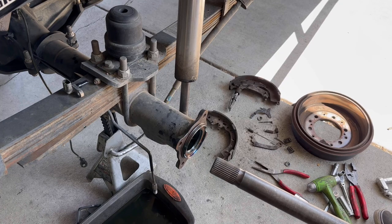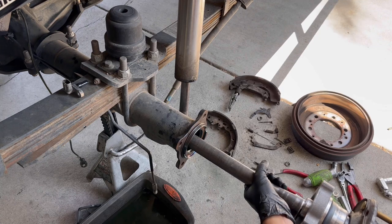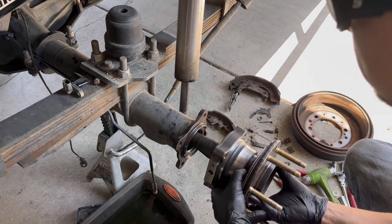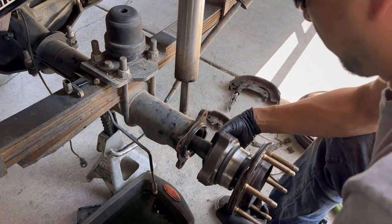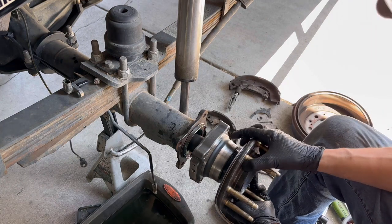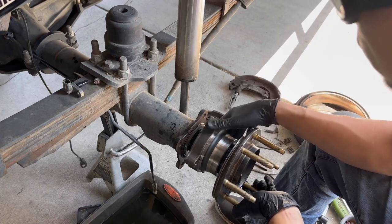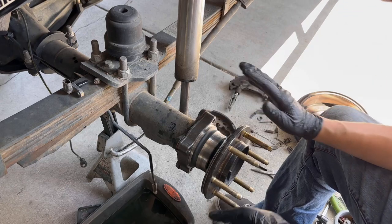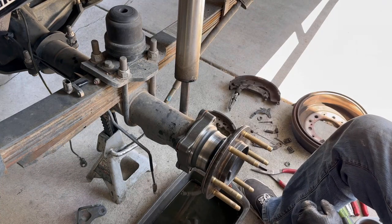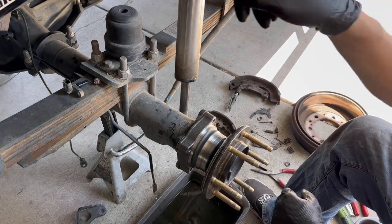When you put this back in, you do not want to let it touch the seal. And then all the way at the end, almost at the diff, there is a little hole that it needs to go in — you don't want to knock it into the diff, so just be gentle. Originally this is going to have the ABS sensor back here, and in the disc brake conversion it says to face it towards the front so that you make room for the caliper. We'll just let this sit here because we still need to do the other side. So this is one side complete for the disc brake kit — we're just going to jump forward to start getting the disc brake installed after I handle the other side real quick.